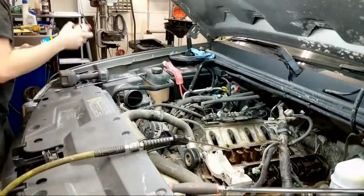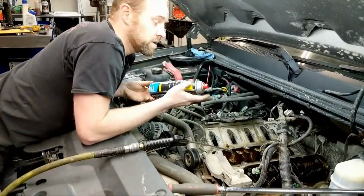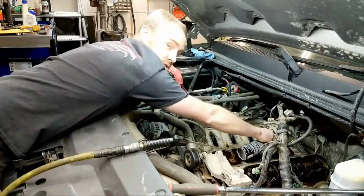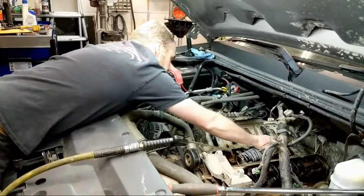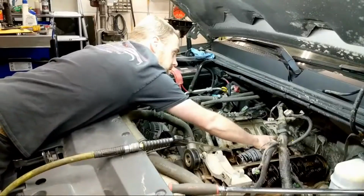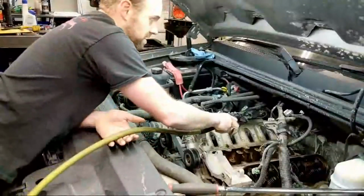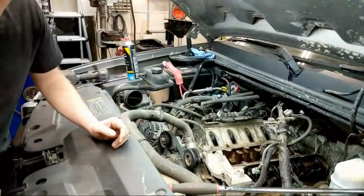Alright, to get the oil out, and I'm going to explain why in a minute, we're going to use a little brake clean down the hole, which dries out the lube surface area. I understand that, but I'm more concerned about being able to get that lifter free. I just saw the sensor, so that tells me I have the oil cleaned out of that hole for sure now.